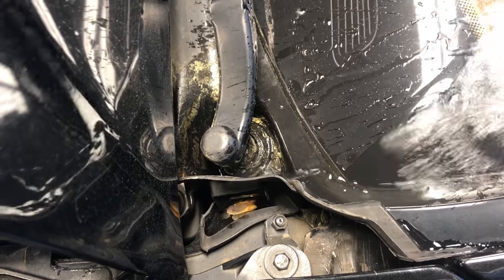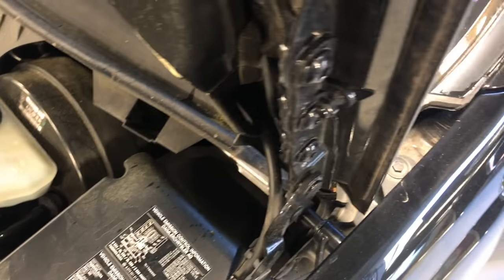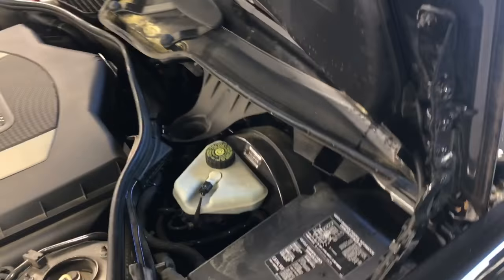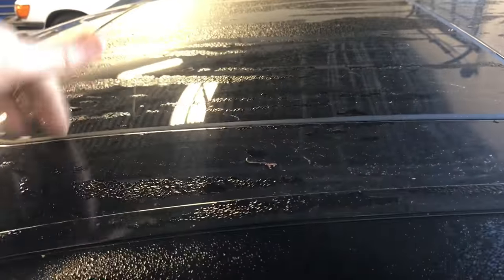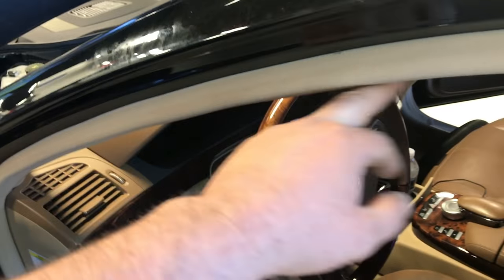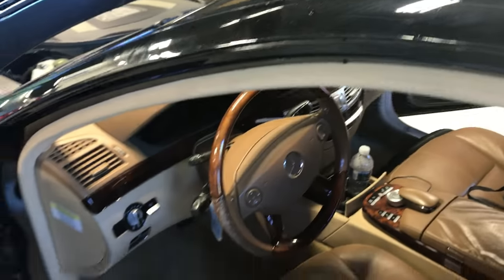When it's raining hard, it's not going to drain fast enough if it's partially clogged, and the water is going to start to climb over the drain and get into the electronics, and from there into the cabin itself. One of the routine maintenance items is to make sure your technician cleans the drainages. There are also drains on the sunroof — water getting through the sunroof isn't the problem; the problem is if it gets into the car. If the drainage is clogged, water from the A-pillar area will start to drain inside the car, which can rust your roof and cause other problems.